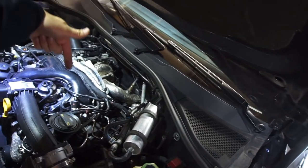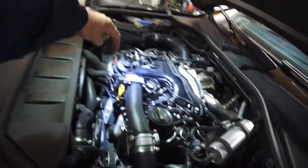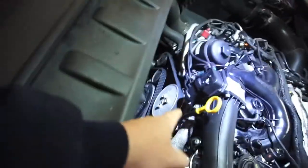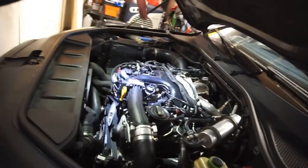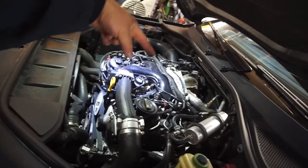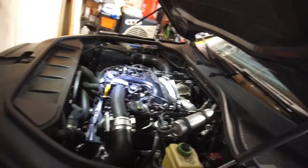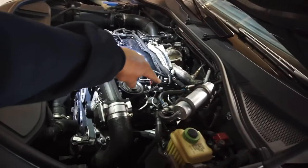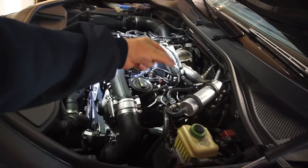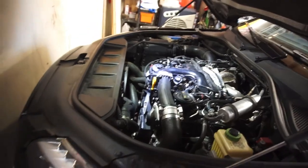I looked all the way back in there and was able to snake the camera all the way through — I've got no new leaks, nothing. There's just a little bit of wet residue from this plastic piece up here that I couldn't get back and clean because it's underneath. When I sent the borescope camera down this way, that's all I see is wet. I was able to go all the way around the oil cooler from that side and check the little piece I replaced — everything looks dry. There is some wet over here but I smelt it — it's diesel from the line.